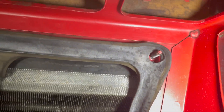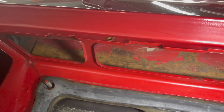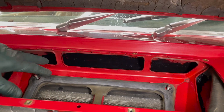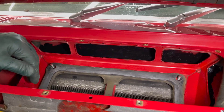I'm going to come in here and clean that rust surface with a little bit of acid, then coat the entire area with miracle paint. We put on a coat of miracle paint, waited a day, then put on a second coat. That is sealed — we're not going to have to worry about that rusting.